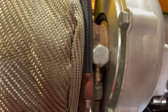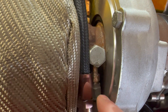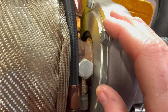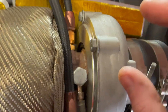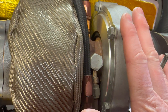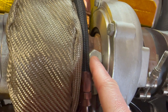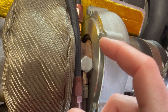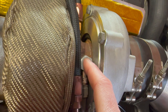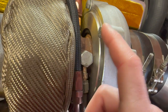If you don't restrict the oil pressure going in, you're going to be running straight engine oil pressure in there and it's going to be too much — it'll eventually blow out the seals in your turbo and you'll be smoking out the exhaust. It depends on if you have a journal bearing or a ball bearing turbo in terms of the size of the restrictor. This being a journal bearing turbo, it only really needs a slight drip of oil going into it. If you want to know the size, it's in the spreadsheet in the description.